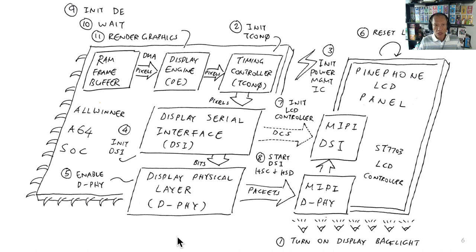If we are doing all this work to teach the internals of a smartphone, we better make sure that everything is documented. Which is why we wrote a stack of articles with whimsical sketches to explain what's really happening inside our phones. We explain the intricate process of turning on the display backlight, starting the timing controller, switching on the power, programming the display serial interface to push pixels to the display physical layer, the frame buffer in RAM, and the display engine. Hopefully our learners will understand how smartphones push pixels to the display, together with the thoroughly documented NuttX source code.